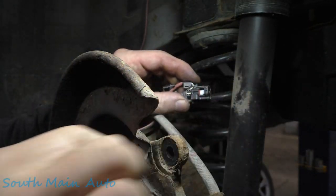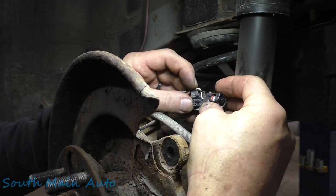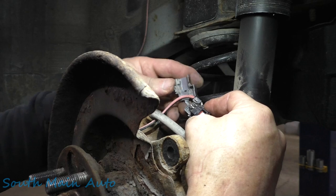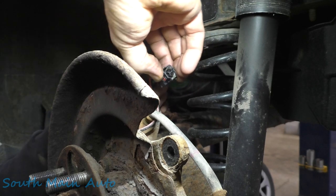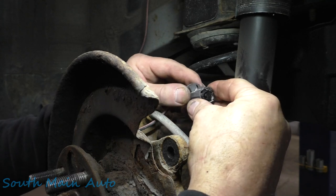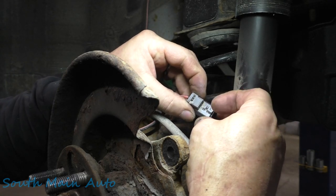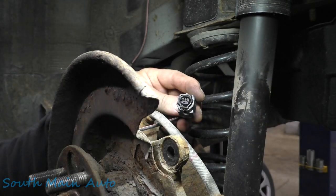In case you're wondering, that's how this sits inside of, I'll try to do this way, keep my hands out of your way. So the connector here, wire goes up on top, and then you thread the wires down to there. The connector sits in here, the release tab is right there. See if I can get this. I'm trying to do it where you guys can see it here, but. Come on, baby. Get that around like that, here we go. And the whole thing will click back together. Like I said, your release tab is right underneath it. To get it while it's in the vehicle, you just gotta get a pocket screwdriver, flick these tabs loose, and that'll come apart on you. Anyhow, for what it's worth, that's that, fellas.